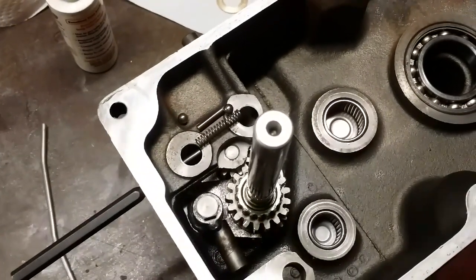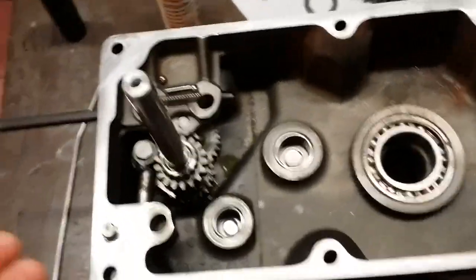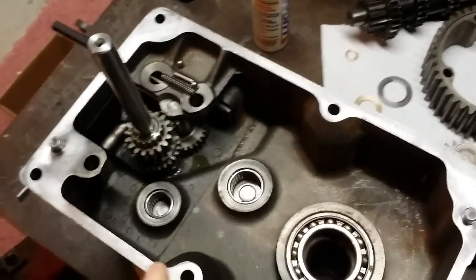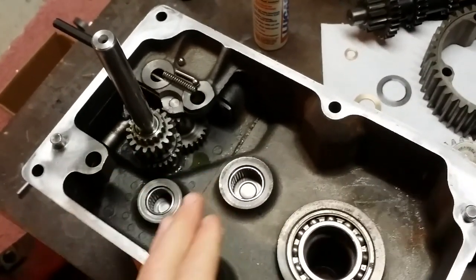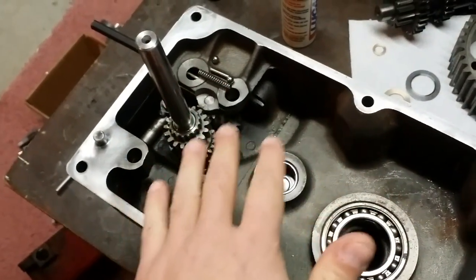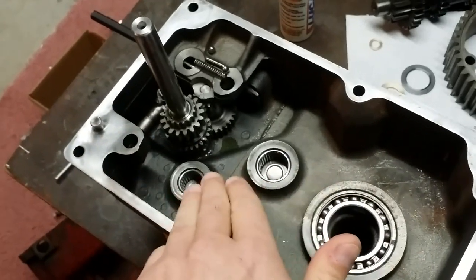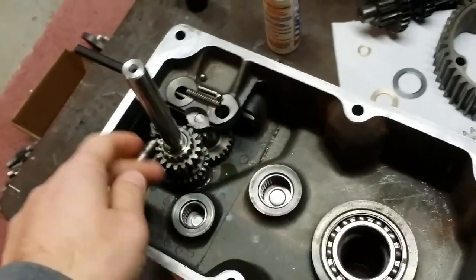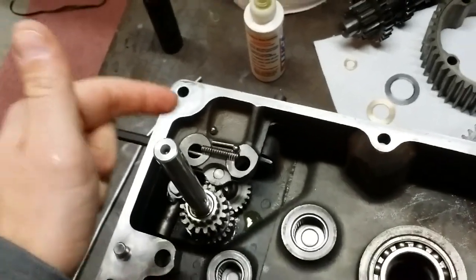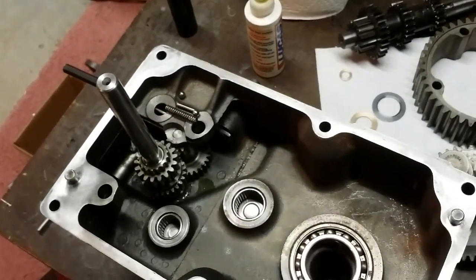It's probably going to take me about 10 different times in order to get it to work, so I'll only bore you with the one that was successful. All right. Now, again, this is another one of those period times where I'm going to put the other shafts back in first. So when we set the camera back up, you'll see that the other shafts are back in place. I will have pre-lubed everything all together so that way there's no need to pull them out again. And hopefully both of those shift forks will go in.